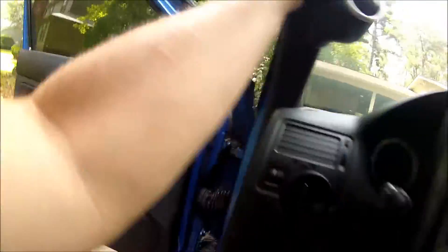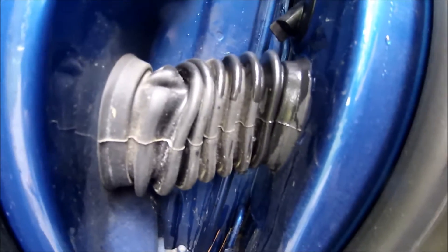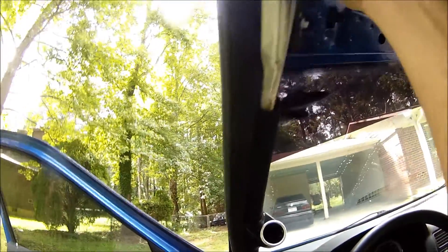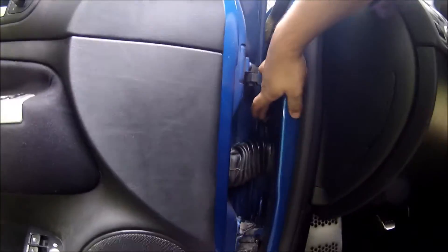Just make sure to put this back. After you clean this drain and put it back in place — if you needed to remove the headliner — now you just gotta blow so all the stuff inside the hoses just goes out. Believe me, if that thing was stuck, it doesn't matter how hard you blow, there's no air that's gonna come out. So right now you know it's good.